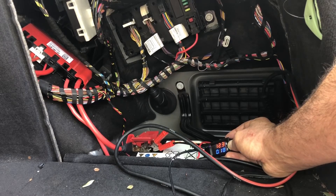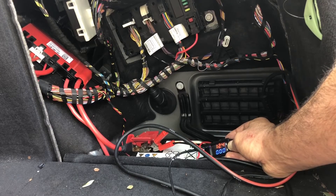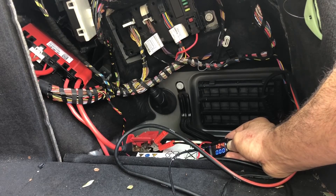For this car, after 20 to 40 minutes you'd normally see 0.02, which is good. That's an important number — it should stay in that range without jumping. It's almost zero. At this point the whole system is sleeping: 0.02, about 20 milliamps — really good. Some modules of course drain a tiny bit, which is normal, but this is good. It means the car is not draining anything significant.